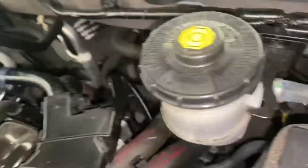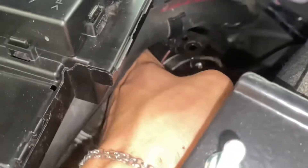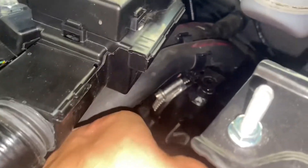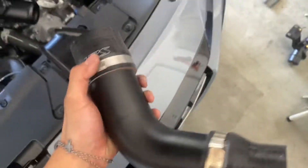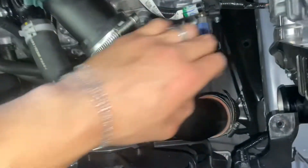The next step is to put the charge pipe into the reducer. The charge pipe to reducer connection didn't come with a clamp, but I don't want any boost leaks, so I'm gonna clamp it just to be safe — better safe than sorry. Then you connect the second part of the charge pipe. A quick tip: when installing the second piece, try to put it in facing downwards first and then flip it up.